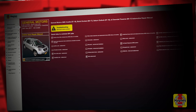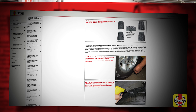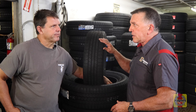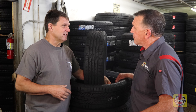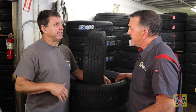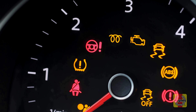Check your cold tire pressure once a month — that's sufficient. Tire pressure monitoring systems give you a wireless connection to your tire pressures. Before TPMS, you needed to visually look at your tires at just about every fill-up. Nothing else would tell you. TPMS is a great invention — it saves blowouts, saves tires, saves gas. The manufacturers basically said, 'They're not checking their tire pressure, let's put a monitoring system in there.'